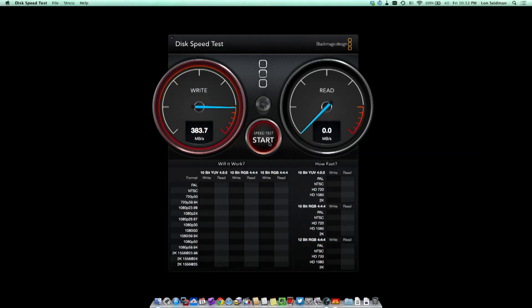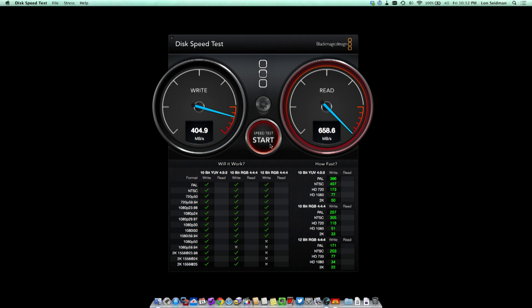The next thing we're going to do is connect to the RAID array I set up. Presumably we should see double the performance, and we just about get there. Now we're seeing much better results — the writes are in the 400 megabyte and change territory, and the reads top out around 650 megabytes per second or so. That's about 5 gigabits per second, so we're kind of hitting the tail end of probably the SATA controller inside the device. In fairness, this is not a RAID device, so it's not really designed to be used this way, but it's a great way to test the maximum bandwidth. We should be seeing maybe another 100 to 200 megabytes per second in read speeds if we were really getting the full Thunderbolt speeds, but 5 gigabits is certainly nothing to sneeze at — that's a pretty good result, especially for something not designed as a RAID controller.